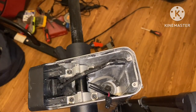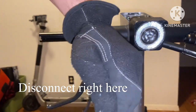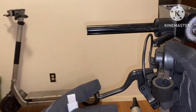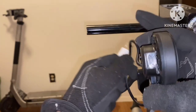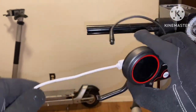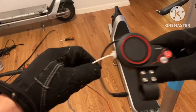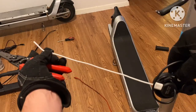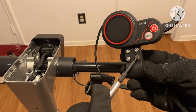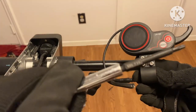Now we're going to be replacing that with this — it's going to take the place of that cord going straight down here. Before I install my throttle and display, instead of having to go inside my controller to get a 5-volt supply, I'm gonna get my 5-volt supply from the headlight through this USB right here. That's going to be for the headlight. I'll cut this to about 12 inches in length — that's all I need. Go ahead and install our throttle — you only have to loosen up these two bottom screws using a T15.